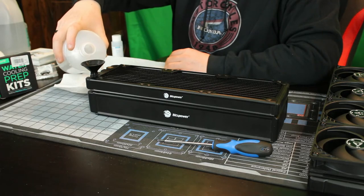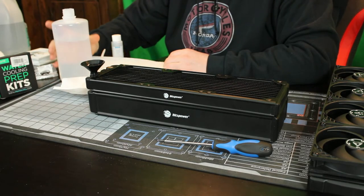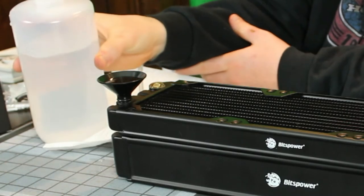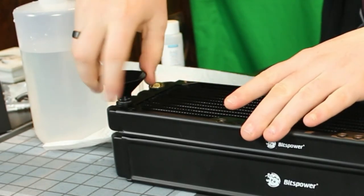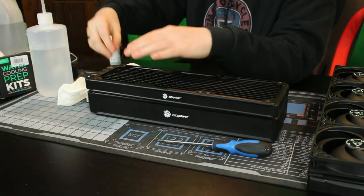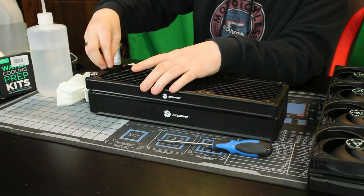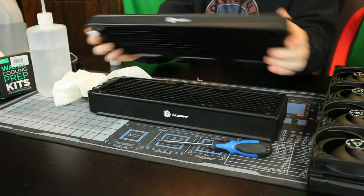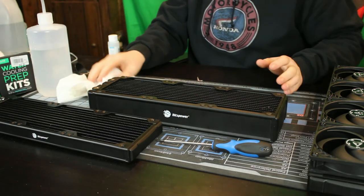I bought four 32-ounce bottles of the fluid I'm going to use, and I feel like two of those are going to be useful for a re-clean and dump of all the liquid. This is where things can go awry — you put a little bit too much in and you get it everywhere. Attempt to clean your mess up a little bit, then put your last fittings back on. You don't have to tighten these down like crazy — these are just the stop fittings that came with the actual radiator. Then shake the thing, get it moving around, and let it sit for an hour. Then we come back and flush it out.